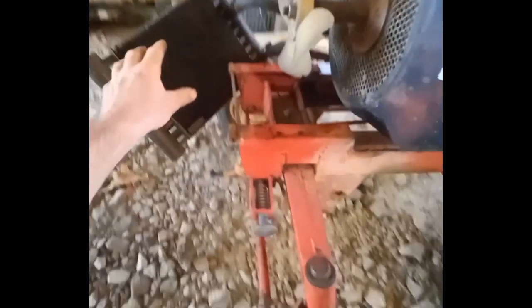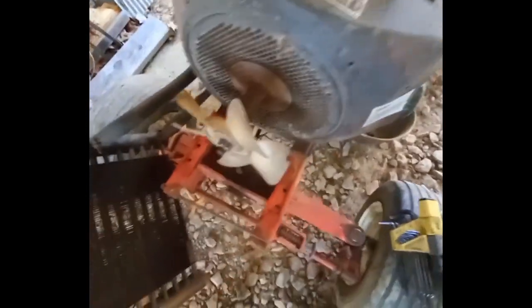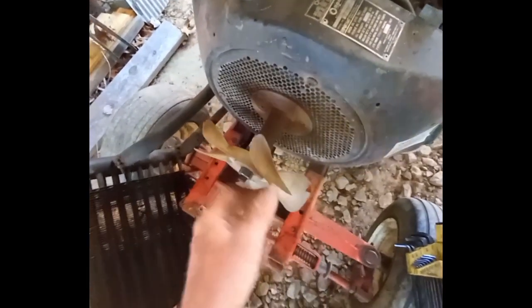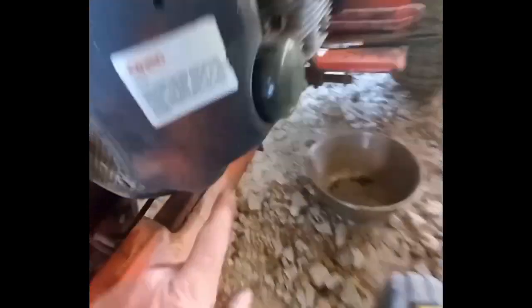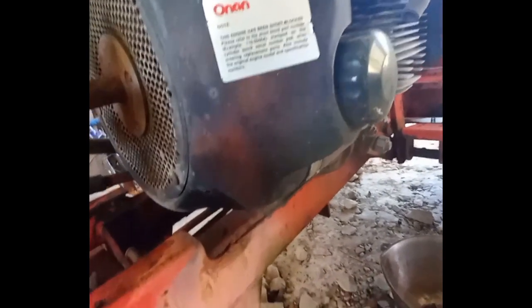You have to take the hood off, the oil cooler shroud has to come off here and here, the exhaust pipes have to come off, then the fan cover has to come off — but to do that you have to pull the fan. If it was all together, this would have a mower deck clutch on it. You'd have to pull all of that stuff off just to get to these bolts in the front of the starter. They couldn't have manufactured a removable section right here to save you a day of labor.